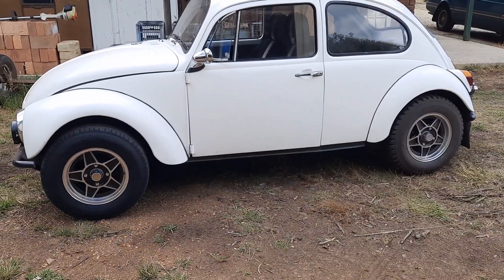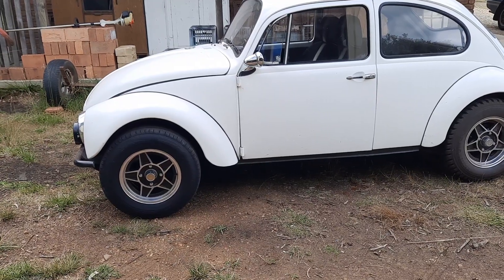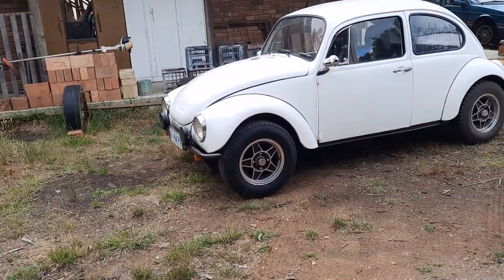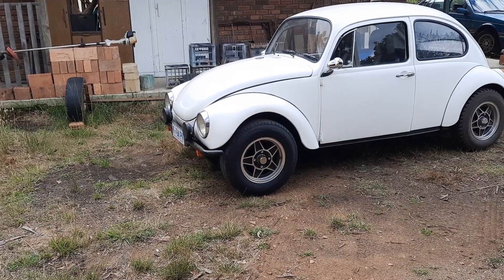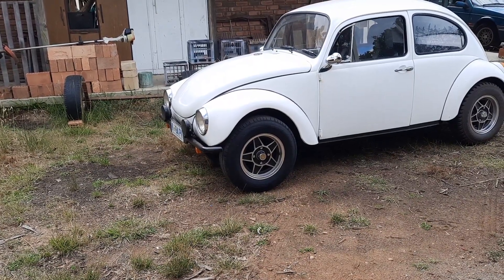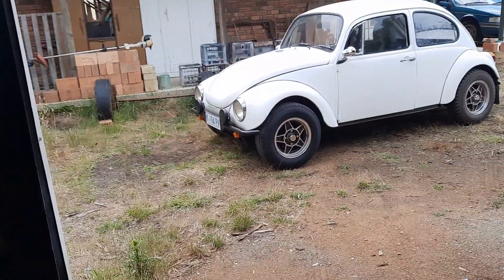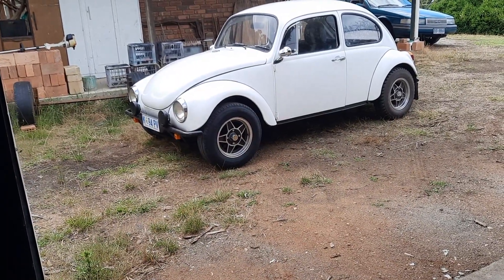Getting the front tires up to the correct height has brought the front up again. The bull bar is still hanging down a bit low, but it has to be to protect the torsion bar and torsion bar mounts on the front. To raise that up I'd have to change the torsion bars. Where the bar hangs down low, it's in between the wheels and further back than the front of the wheels, so it shouldn't be that much of an issue.